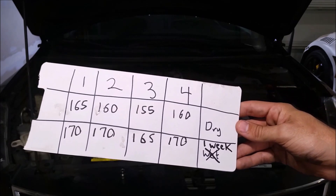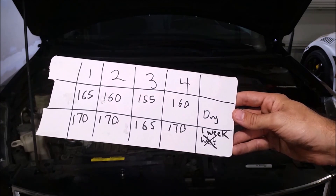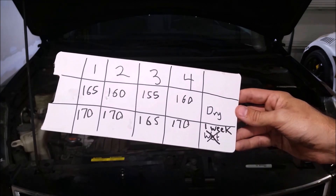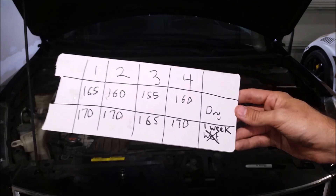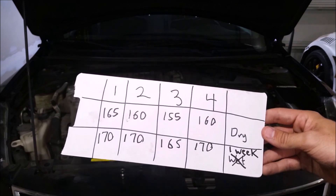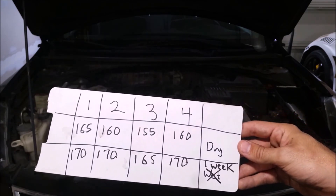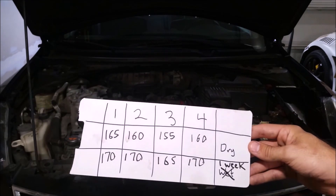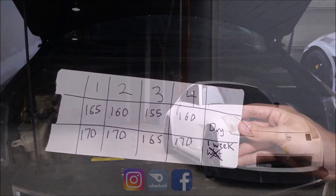We did see a slight improvement — even 5 PSI across the board is still significant from just something out of a bottle. I didn't go in there and do new rings. I'd call this a statistically significant result. I'm going to recheck this in six months to see if it lasts or if it's just a band-aid. From other videos it seems like it does last — whatever it does, it's just helping the rings reseat to the cylinder walls and smoothing out imperfections. If you have any questions, drop them in the comments, hit that subscribe button, and I'll see you guys next week.